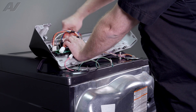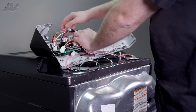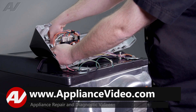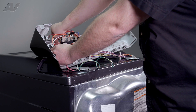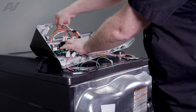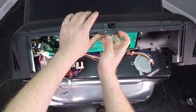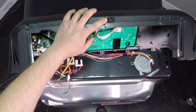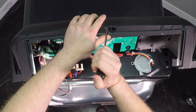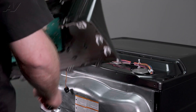Start prying the relays off. When you pull on these relays, make sure you put pressure on the actual relay while lifting up. We have a connector on the top here that will also have to get pushed through. Use the tag puller — there's a little clip on the side that pushes in and pushes down — and you can set your console aside.